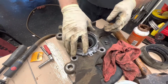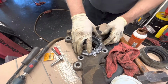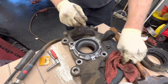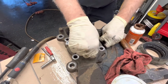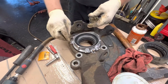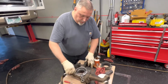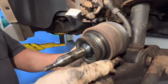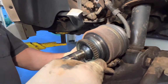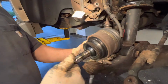Fitting is up here. It fits in really nice and easy. And we're going to catch our bolts that we've already got never-seized and all lubed up nice. All right, so we're going to torque these and grease this up, and we'll be ready to go. So here's the spline we were talking about. You want to make sure your axle is nice and clean here. This is all nice and clean, and your teeth are good and lubricated here, which ours are, and we have a grease fitting on ours, and that's what's going to get grease in there.